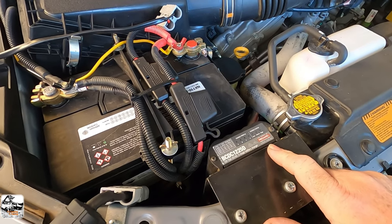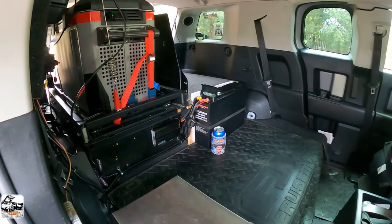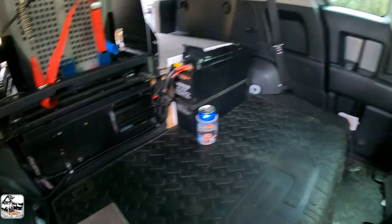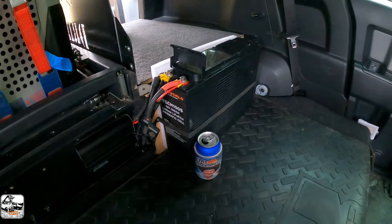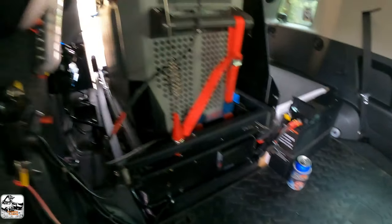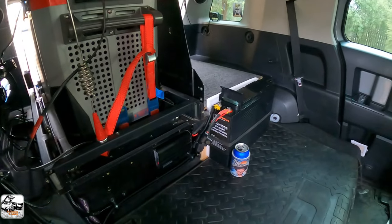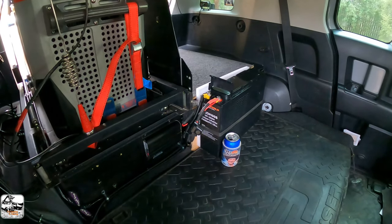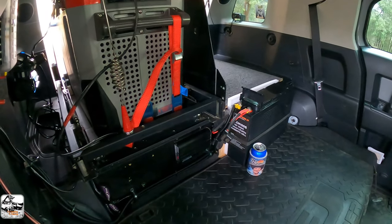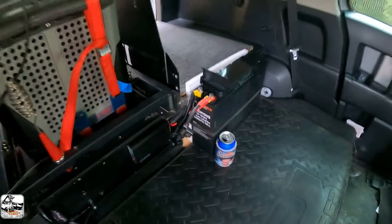Let's have a look now in the back of the car and see how I've installed it. In the back of the car, we've got everything. I've wired all this up the other day, pulled all my old drawer system out of the back of the car here. And I've got my new iTech World Slimline battery all wired up. Just got to build all the boxes and everything around it. It's been running great. I've had the fridge running for two days now and the voltage of that battery hasn't dropped below 13.4 volts. Sits on about 13.5, and overnight had the fridge running, cycling all night, got in it this morning - 13.4. Bloody beautiful. If it stays like that, I'll be really happy.